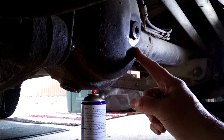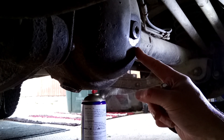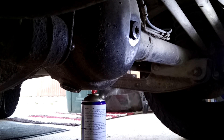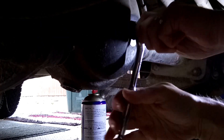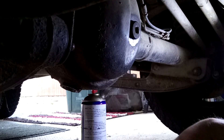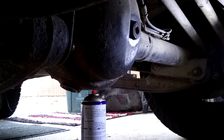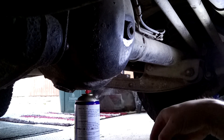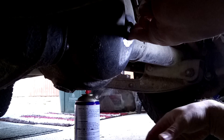Always do your top one first — there's no point draining the oil if you can't top it back up again. I have actually pre-loosened this one just to make sure. Pop that underneath just to make sure we don't drip anywhere.